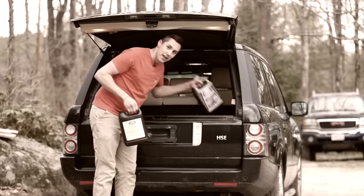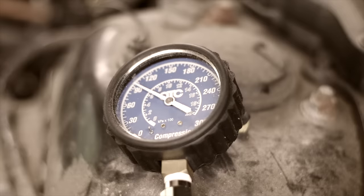This brings me back to part one where we found half-empty bottles of coolant in the boot. I found the previous owner's business card and called him, and when I asked about those bottles he told me they were from when he had the water pump replaced — he never mentioned overheating or a head gasket issue. I wonder now if the water pump was leaking so much that the coolant ran low and overheated, causing a head gasket issue. There is also a lot of water vapor coming from the exhaust when the engine is running. We tested the compression and results were pretty decent, so if there is a head gasket leak, at least it's not very bad.